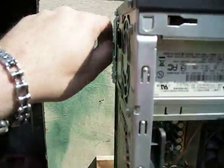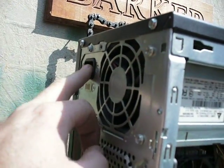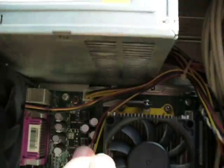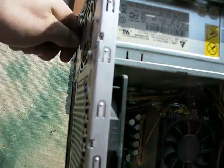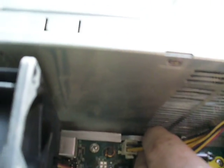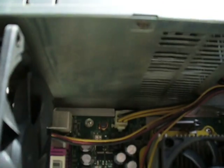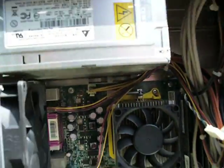I actually had to pull the main plug back here again after taking the PWR2 off. Then I shut it down, plugged it back in, plugged this PWR2 connector back in — took it completely out and put it back on — then powered it up with it off. And guess what, it started back up and went right back into Windows.